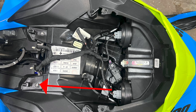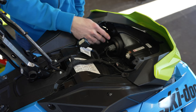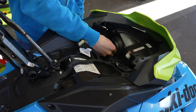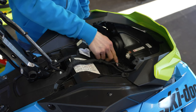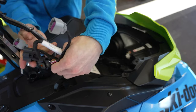Now you also have these two Torx to remove here — we'll go ahead and do that. I just changed the camera angle so you guys can see a little bit better. Now we're gonna go ahead and remove the wiring going to your lights. There's one here in the middle as well, so we've got three more — four in total with your dash. Just push down on the clip and pull back. Same thing for your other light, and then the middle one — push down. You can actually hear the click on this one. And then we'll just put this up here.